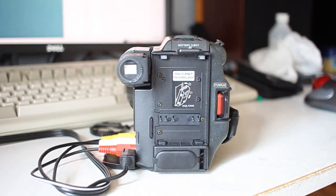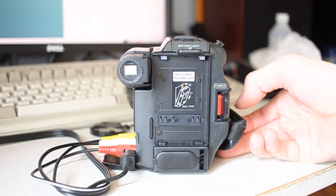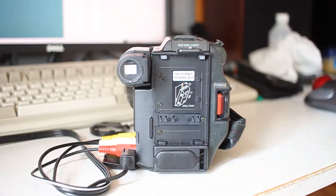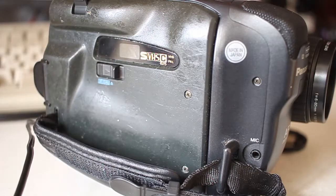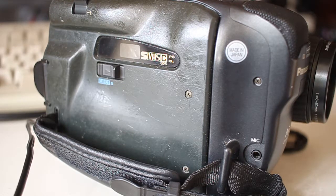It'd be nice to use them as camcorders, except that the video cassette mechanism doesn't work. It actually does work - it just doesn't work properly. I've got some video clips that I'll show you shortly. It loads the tape fine, but basically the head drum makes a real racket and doesn't run smoothly. Apart from that it does work, but it's no good if it can't play the video steadily and if it makes an awful lot of noise.